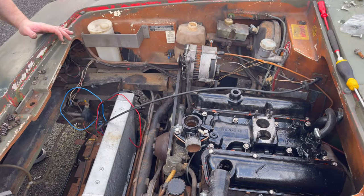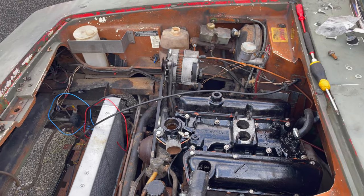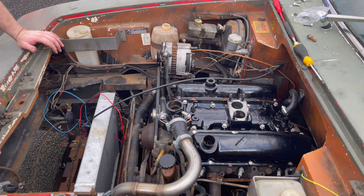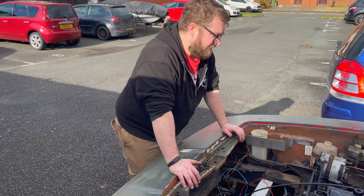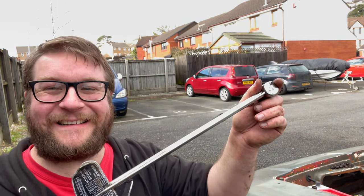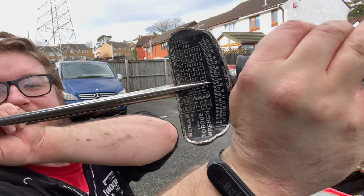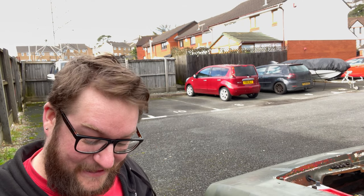The main thing is that the car is functional — this is not a show car by any stretch. All the bolts on top of the engine are in and in place, which is great, but they're not torqued to spec yet. I want to do that before I start doing the carburettor, because they'll be harder to access at that point. I've heard back about the inlet manifold bolts — we're going between 16 and 20 foot-pounds on those, and for the rocker covers and thermostat housing it's just hand-tight with a spanner. I'll get the oldest torque wrench ever — look at this beast. Thank you father for the loan of it. Unlike modern torque wrenches that click, this one has a readout and it bends as you do the bolt up.